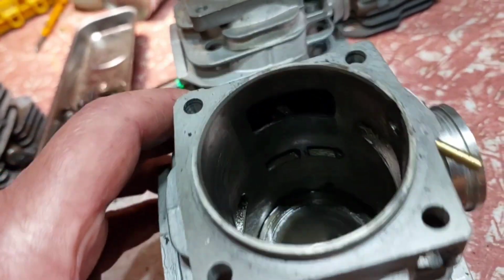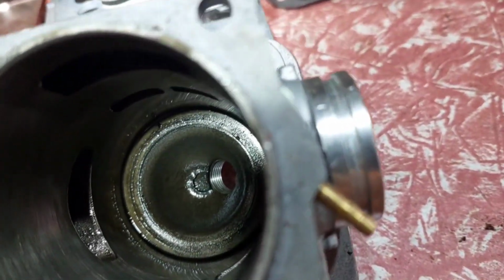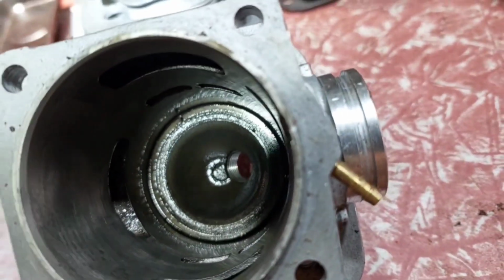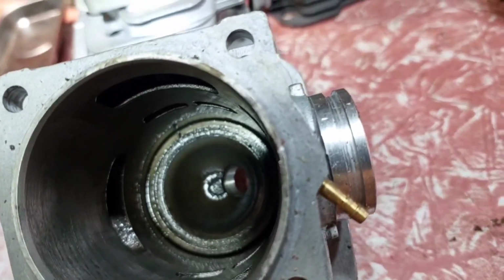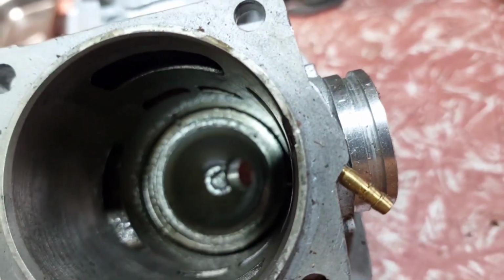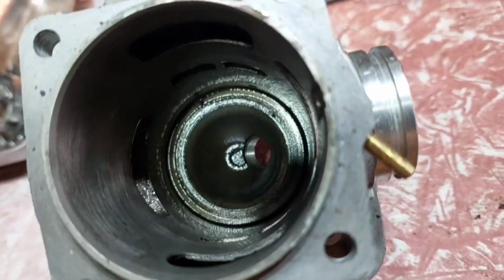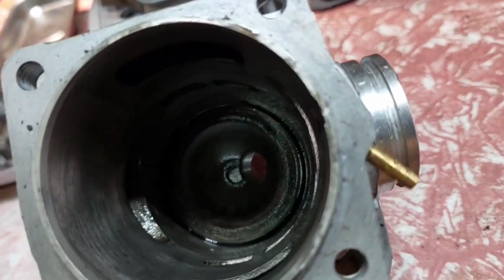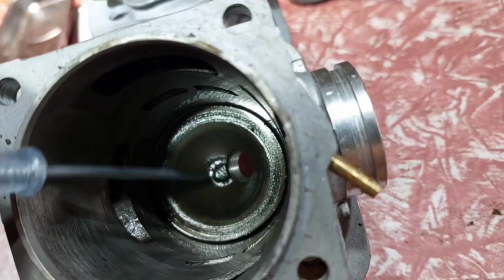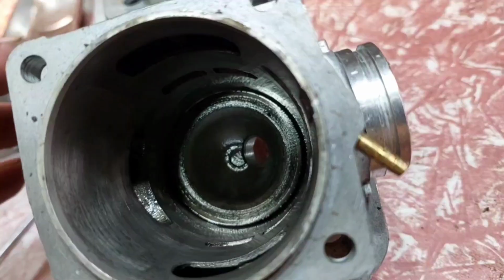Now, I'll move on to some Husqvarna stuff. Now there's the Husqvarna 395 clone cylinders. You look at that, it's the same thing, big combustion area, which helps. But I've done the 395 clone, ported that one, and it just doesn't have the oomph that it should. I don't have a big bore kit here, but the big bore kit has a lot smaller combustion chamber, so it's a lot better. If you look at this cylinder, the casting marker there is a bit of a dimple. So that's even less compression.